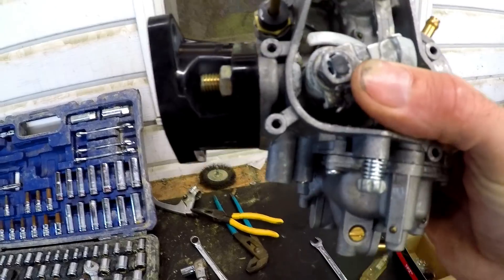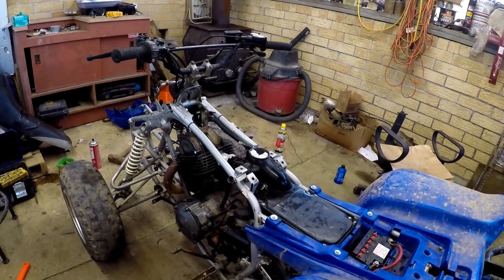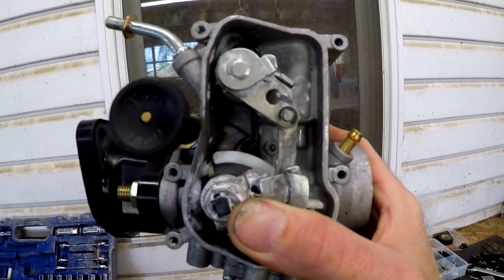That is a much nicer fit — you can tell the end of the intake manifold is angled, so it actually fits properly. The old one really wasn't, so it was a pain getting it lined up. Let's go ahead and get this guy bolted on, hook up the throttle cable, get all our fuel lines and fuel tank back on. Hopefully with these bigger jets from the old carburetor now in the new one, this guy will run good — otherwise we'll be back to square one. It's always interesting buying an old used machine because you never really know what you're going to get into.